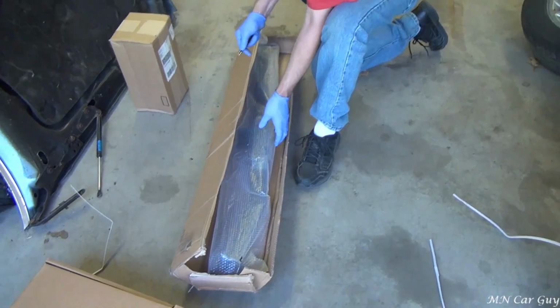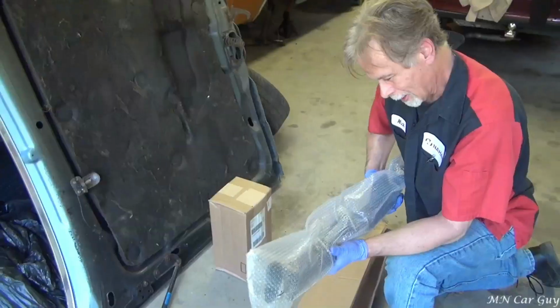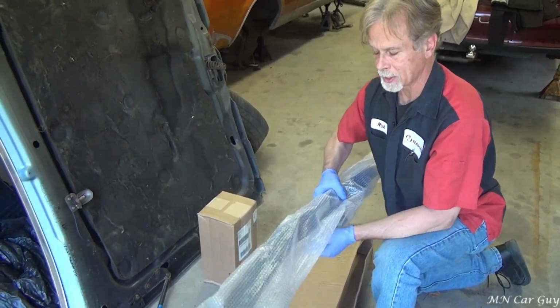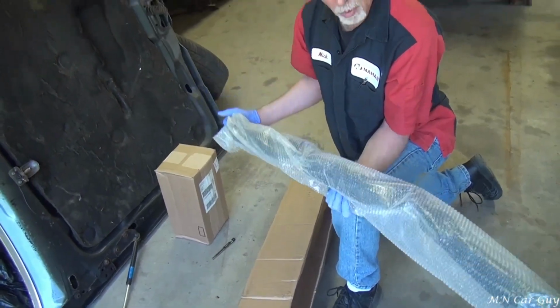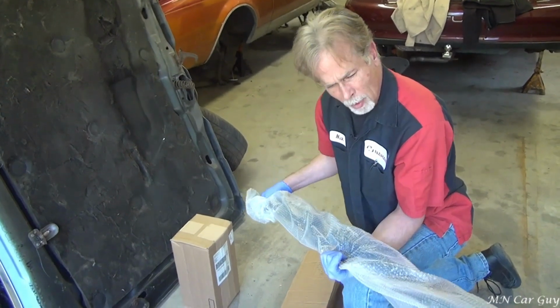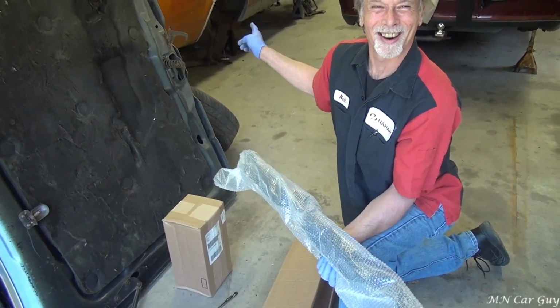This is indeed the transmission crossmember. The old one that was in here only allows a single exhaust, this allows dual. Weighs considerably more than this. And there's a crazy angle on it as well. But there's 2 locations to mount this. That's what's cool on the car.